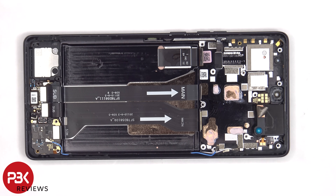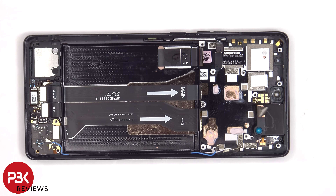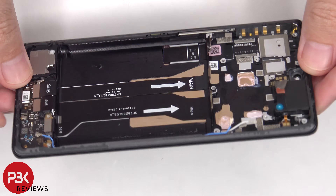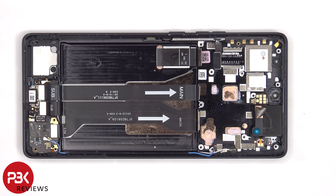If you needed to replace the screen, you would have to remove the back plate, as well as the screws on the top plastic cover and the cover itself. You would have to disconnect the battery cables and the screen cable, and pry the battery off, giving you access to the screen cable, which is routed through an opening in the mid-frame. At that point you would heat up the front of the phone to loosen up the adhesive, pry the old screen off, apply new adhesive and reapply the new screen, making sure you run the flex cable back through the opening in the mid-frame, and reassemble the phone.